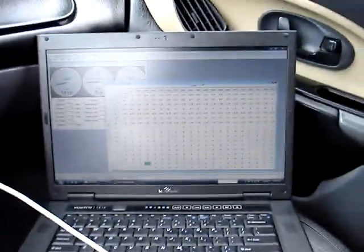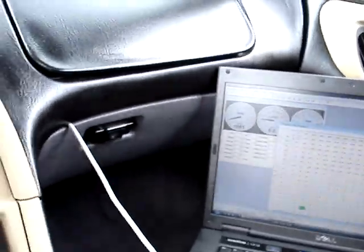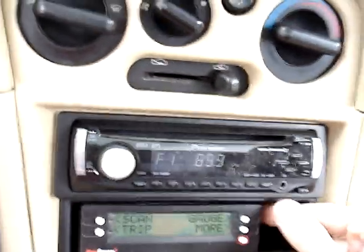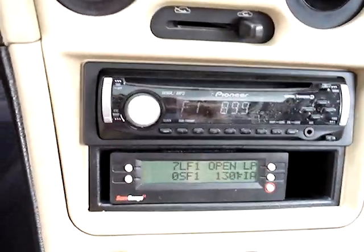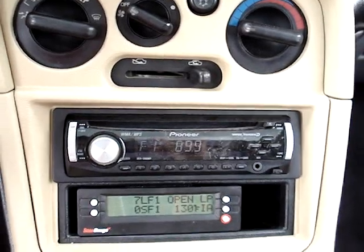There's the software for the FIC. I'm running at 10 pounds of boost right now and I set my fuel trims to zero. I have a scan gauge over here — as close to zero as I can get. Right now it's in open loop mode and it will stay in open loop until it closes, which will take about 30 seconds or so.